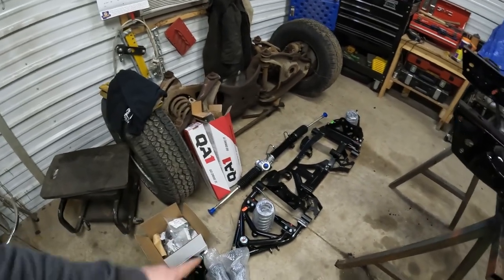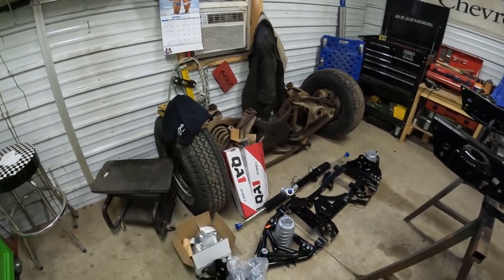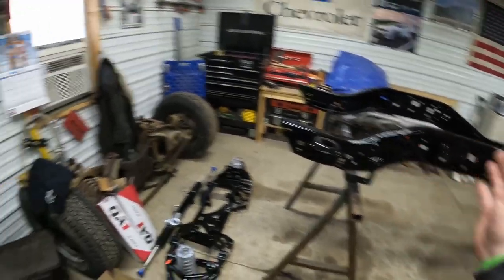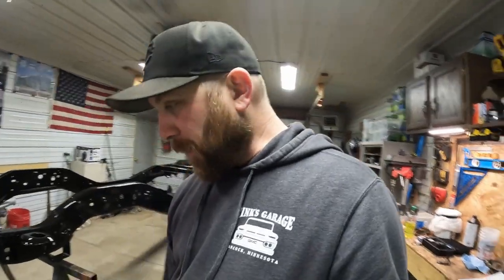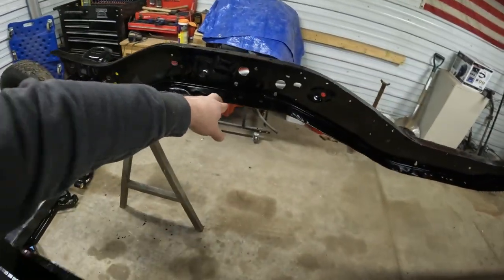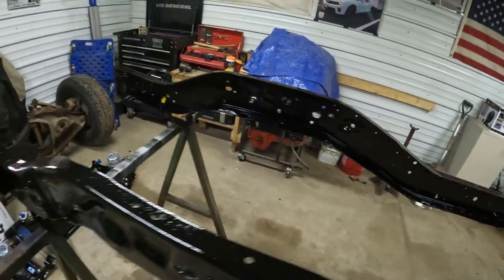It's going to handle a lot better, and this is also going to improve our caster so it'll come back to center better — just an all-around better feel driving it. These old 70s and 80s C10s are a little wobbly driving down the road, they wander around. But first thing we got to do is hoist that crossmember up in there. It's got one hole on each side which we will locate on the frame in the center hole where the old crossmember was bolted.